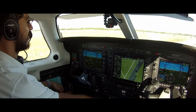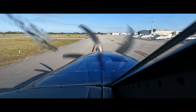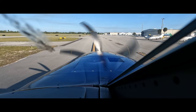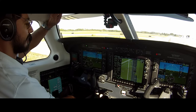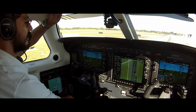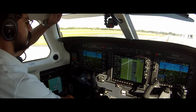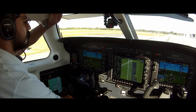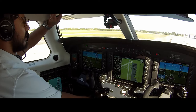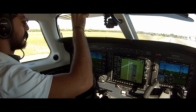Rotate at around 82 to 85. We're entering stage for 28, Lantana. Do a quick engine check here, or a governor check rather. Up to 1900. Okay, there's a drop, and there's a drop there. Bring it back down. That works. Generator off, alternator picks up the electrical load.